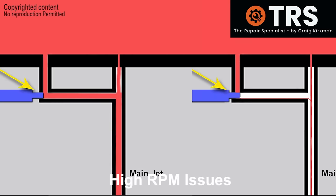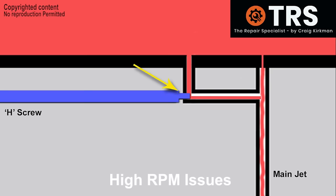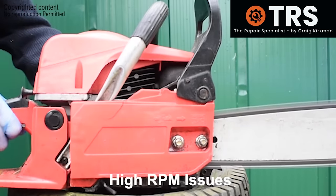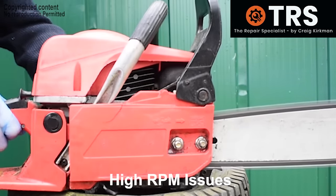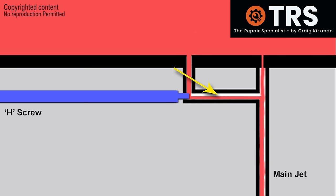In this situation it's worth trying to adjust the H screw again, but this time clockwise inwards steadily until the problem subsides. To sum things up: this is bog due to a lack of fuel going into the engine, and this is bog due to too much fuel going into the engine. There's a clear distinct difference between the two, and when the engine's running correctly it's unmistakable. In terms of high rev settings, the secret to the engine running well at high revs is all determined by the position of the tip of the fuel adjustment screw within the fuel tube.